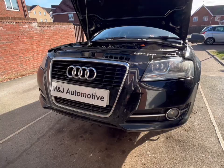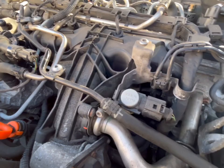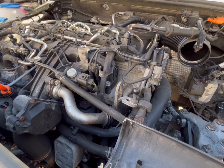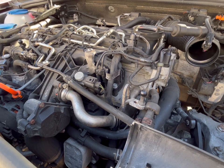First up, as you can see, the oil filter down there. First things first, we'd have to remove that T30 Torx screw to be able to get that bracket out of the way to then get to the oil filter housing. The oil filter housing lid is a 32mm hex for the socket size, 32mm. So yeah, we're having to strip the vehicle, take this off.